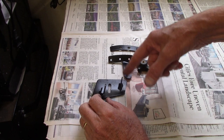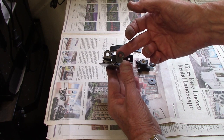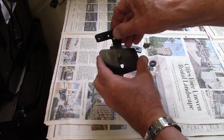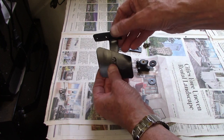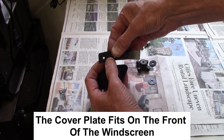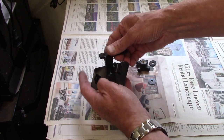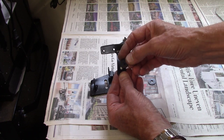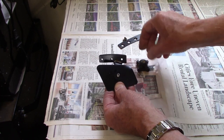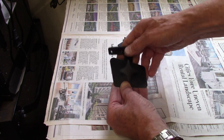This is one of the windshield height adjustment brackets. On the back are a couple of tabs that mount to bushings on the fairing. There's a second piece that slides in the slot — that's how the height is adjusted. A cover plate goes over the windscreen to clamp it using small screws. To make it easier to slide, there are plastic washers and then a second one, and the adjusting knob spins down so it's easy to slide the bracket height.